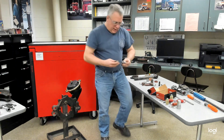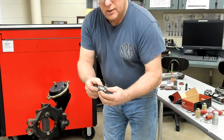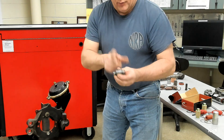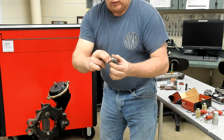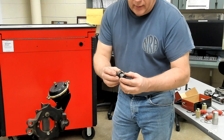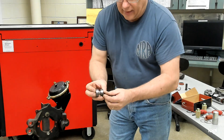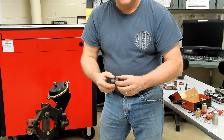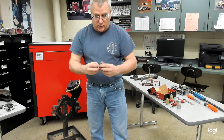The rollers — I have two types here. First is the double-webbed roller, and there's a flat spot right there, really easy to see once they're cleaned up. A flat spot means you can't use it; if it's anything but perfect, don't use it. When reassembling, put a little anti-seize or grease on the edge so it can roll, but nothing on the face where it rides against the S-cam head. The second roller is for a single-web shoe — same thing, check for flat spots. This one has two very noticeable flat spots that will prevent it from rolling properly. There's also rust on it, which may have started the problem of preventing it from spinning as it should. Clean it up if there are no flat spots and you had to reuse it.